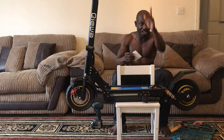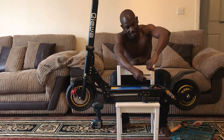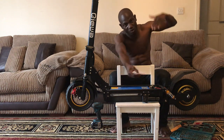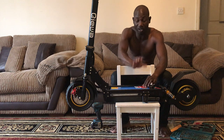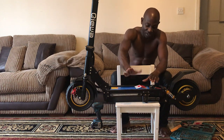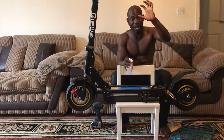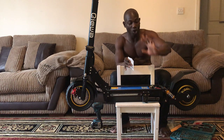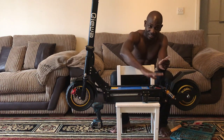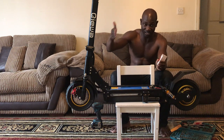Once everything is done, the first thing that should go back is your controller. You hold the cable with one hand and the controller follows, because the cables are not that long, so they will follow the controller. You put the controller on the double-sided tape. You press it down firmly to be sure that it's not moving. Then you put another double-sided tape on the controller and put the black box, which is your alarm system, on that. When you finish all that, then you put your wires in and zip tie them, the way I explained in the previous conversation.